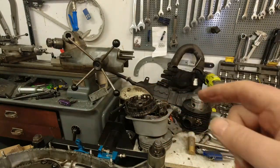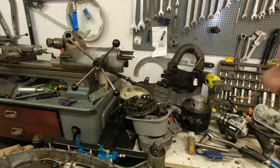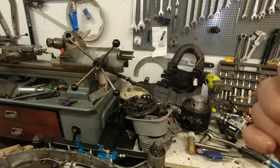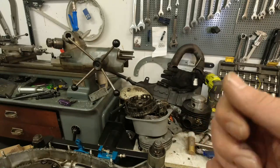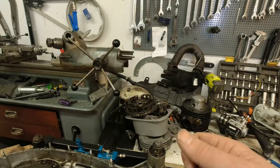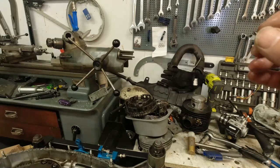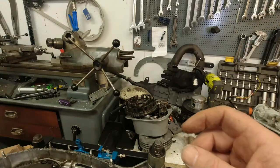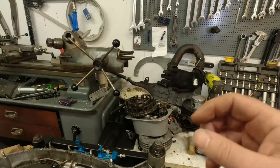So what I've decided to buy there is, we're being really posh, and we're going to fit an LTH clutch. Now that is completely overkill. So we're going for the BGM crankshaft, GP type, with standard stroke, so that means we're going for a 58 stroke, 107 rod length. And the nice thing about the LTH clutches is this sort of lasts forever. If you put those in an original type engine or something under 20 horsepower, you're never really going to have to change your clutch plates.